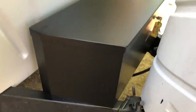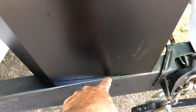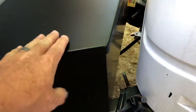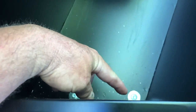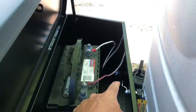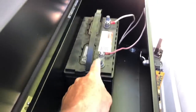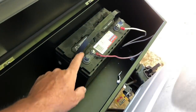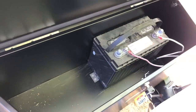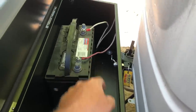Here is the Tongue Box — you can see the fit. It's obviously made for a smaller trailer, but that's completely fine. Underneath is that brace, the old battery rack that I turned upside down. You can see I used two self-tapping screws on each side. My father-in-law gave me a piece of angle aluminum with self-tapping screws — I put one on each side of the battery so it won't shift or move. There's room in here for another battery of the same size, possibly three of the smaller batteries, or four if I went six-volt. I did drill a hole on that side for the wires to come through and put some protective material around the wires.